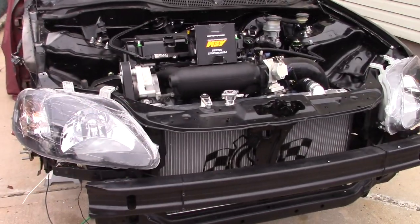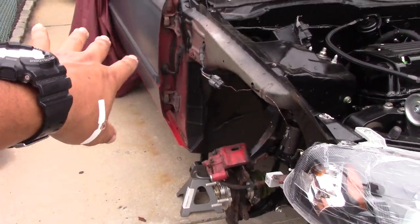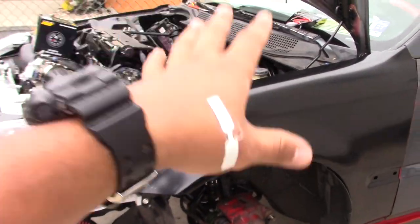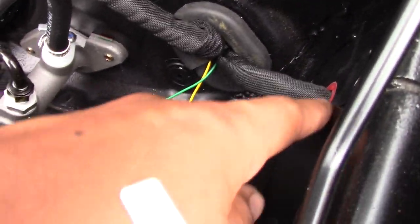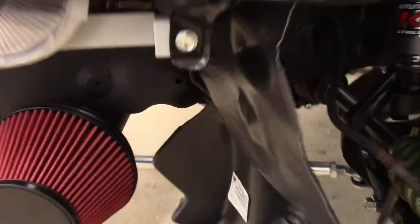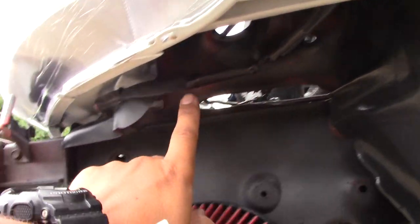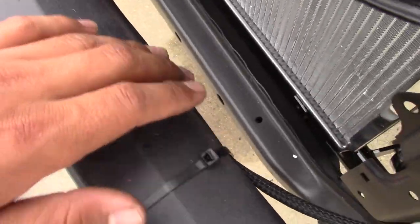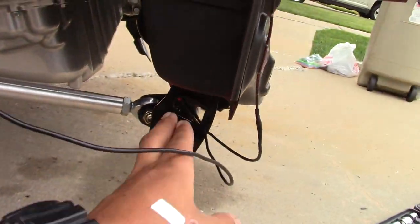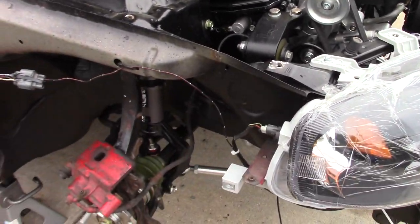Carter's got his headlights in the black housings now — the car is coming together. We just had to take this fender off because we decided to run the fan switch wiring through this fender, kind of like how we did the headlight harness on this side. The headlight harness did run originally in this corner, so we took that grommet out and we're going to put a rubber O-ring here. It runs into the fender, comes this way, connects to the headlight, runs behind the crash bar here, and comes to the other headlight. This is the fan switch wiring which we're going to be tidying up.